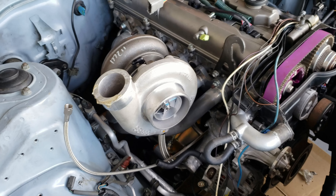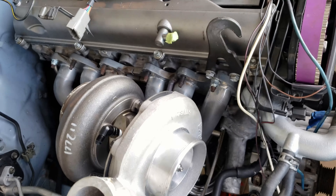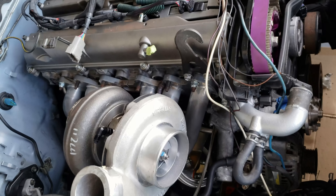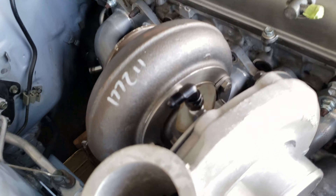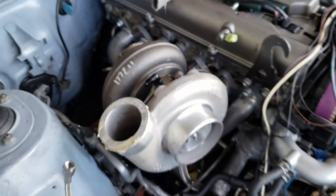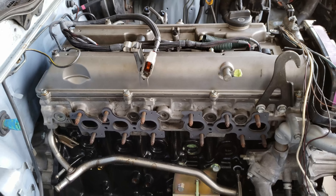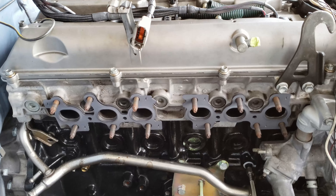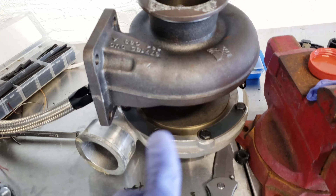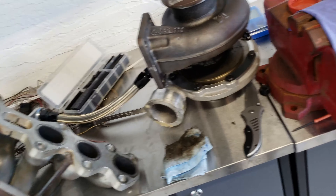I don't have the gasket on, I don't have all the nuts on, I don't have the turbo bolted down. Since I'm here I'm going to bolt all this stuff down. I have a new exhaust manifold gasket and new nuts. Went ahead and put that 90-degree swivel fitting on — huge, that made a big difference. New OEM Toyota exhaust manifold gaskets — check. Clocked the turbo, tightened both sides down — check. Cleaned exhaust manifold mating surface — check. Now time to install the wastegate.